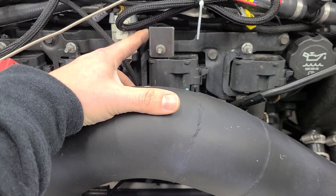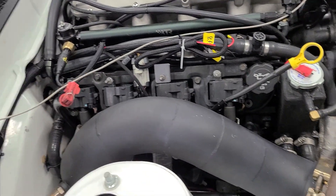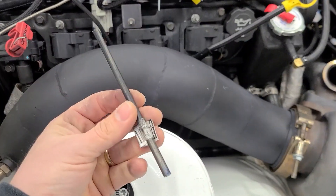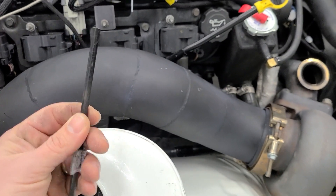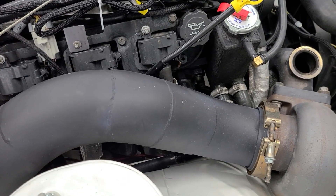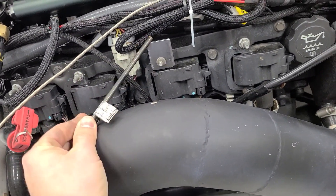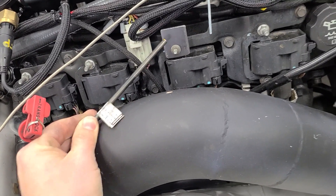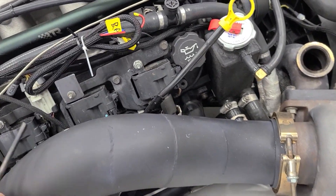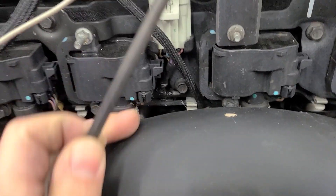I've cut this tab right here and bolted it into this coil bracket - it's nice and stiff. I've been looking at this for like half an hour trying to decide how I want to make a bracket here. Best solution I could come up with was to do a tab right there and then use this round rod - the same stuff I made my headlight mounts out of, just solid quarter inch round rod. I'm going to take two pieces of it and weld right to this tab, and make them intersect into the downpipe kind of down in here somewhere.